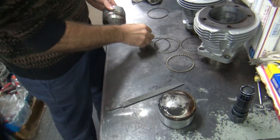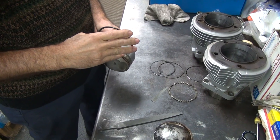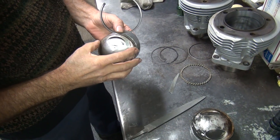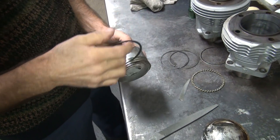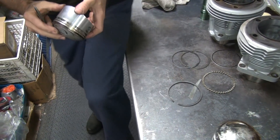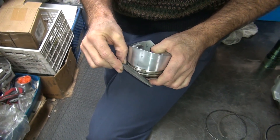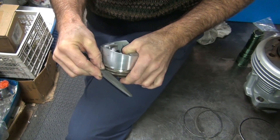So we're gonna try to do it with a coarser file because I don't feel like working all night jigging up your stupid piston to make it work. Hey, it's trying its best. Okay, this appears to be the tight spot on the exhaust side - might be too tight. So why is it tight there? Because it's a race motor. Because the detonation is the same as hitting it with a big-ass sledgehammer. Race sledgehammer. That's right.